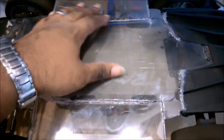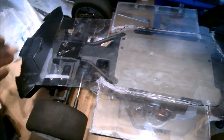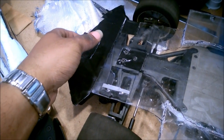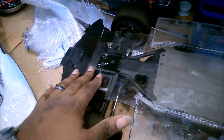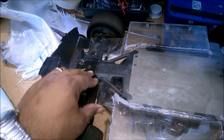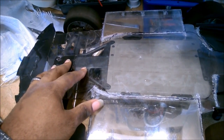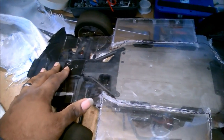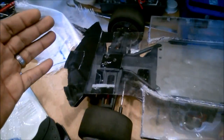To help with the fusion between the underside of the paint and the fiberglass, I'm leaving this piece as-is. This is actually polyurethane plastic — it's not the best, it's brittle. I discovered that during testing when I hit a bump that caused it to bottom out and snap. But for my purposes that doesn't matter, because I'm fiberglassing both sides — this is basically just a form in the middle. The strength is all going to come from the fiberglass. I've also got some gorilla tape reinforcement in there just to hold the shape together.